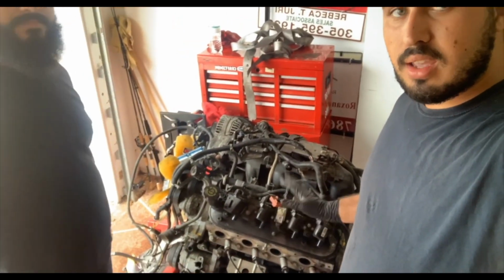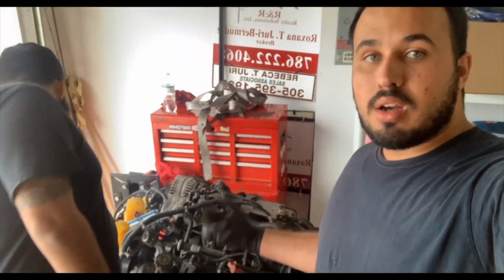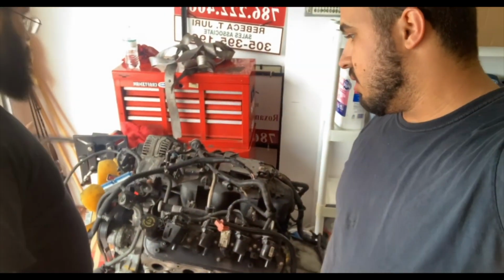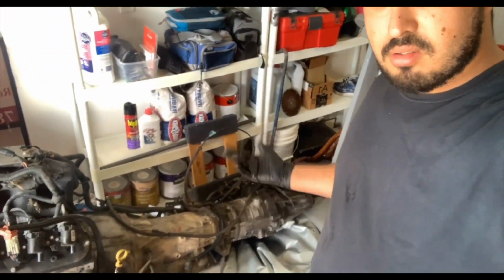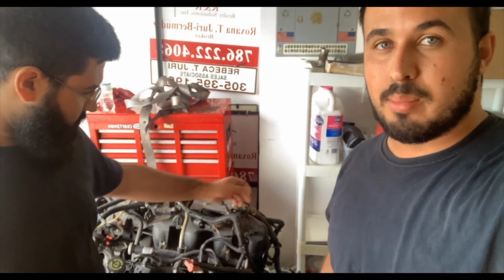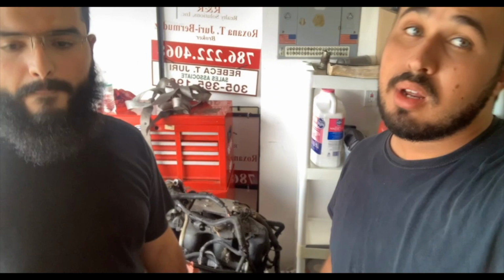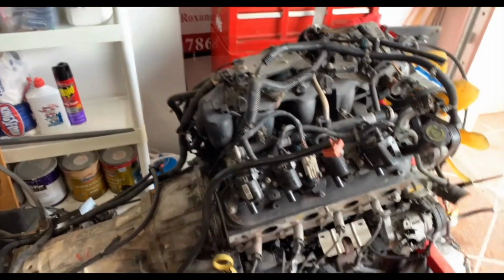No car today, motor work only. We're going to take out all the wiring harness, get rid of it, we don't need it. We're going to order the Holley. Transfer case, selling it, not going to build it. I did the numbers, TH400, about the same price, a couple hundred more, rated for more power. We're going to take everything off, split it at the bell housing, take off the starter, and put the engine on the stand.